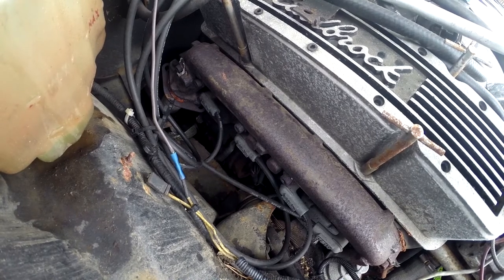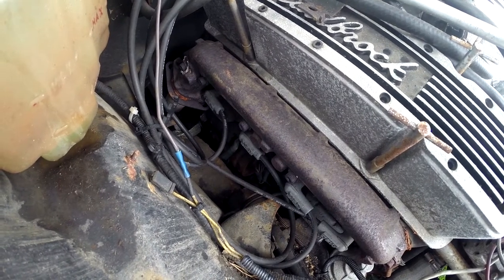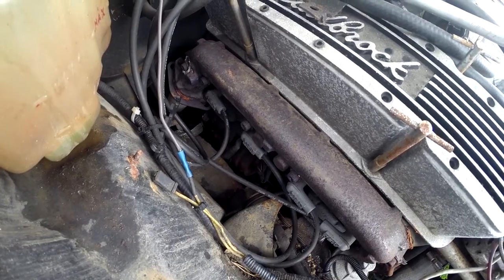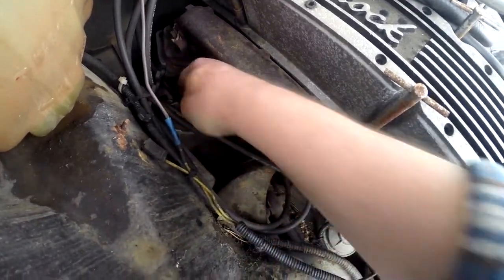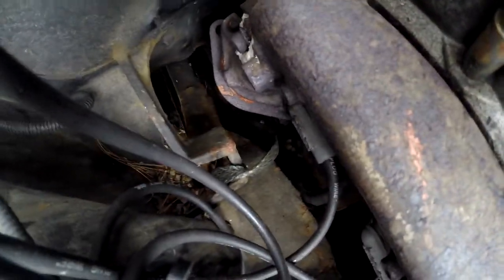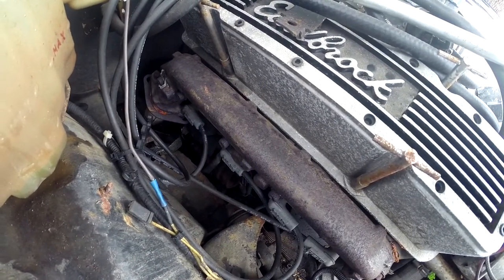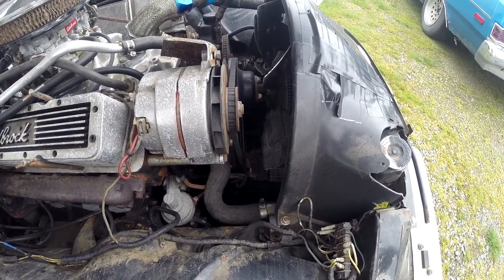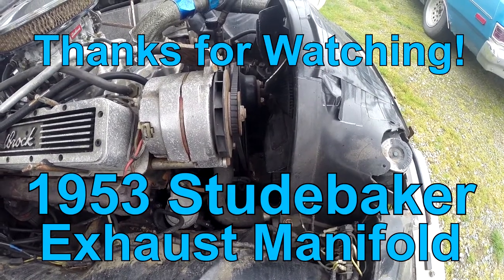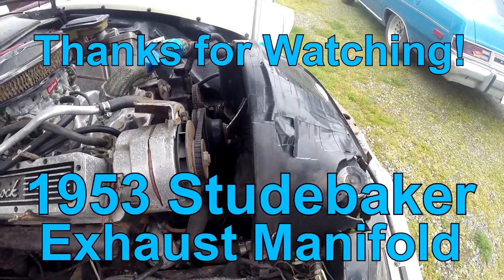Depending on what I do, if I get some old-school manifolds I might just leave this side alone. I do see a whole bunch of gunk — gasket goo crammed in there. I recall this had a different leak issue where the back cylinder was always kind of blowing out. You can see an attempt at a repair from a long time ago — that's not gonna cut it either. The more I look at this car, the more little things I find: all these hoses should be replaced, the fuel line, the fuel pump — there's a lot going on. Anyway, that's it for now, talk soon.